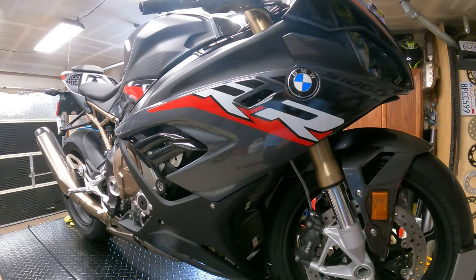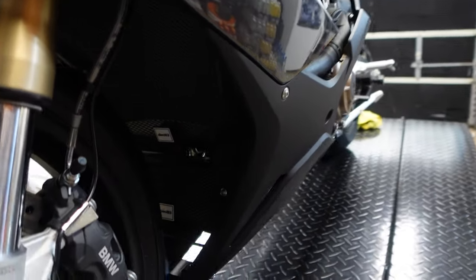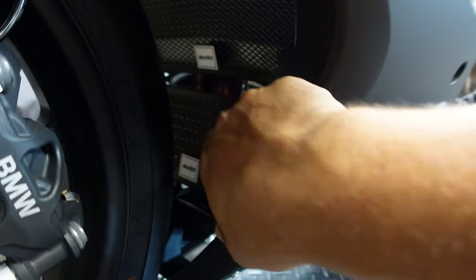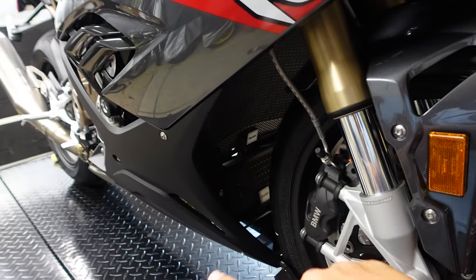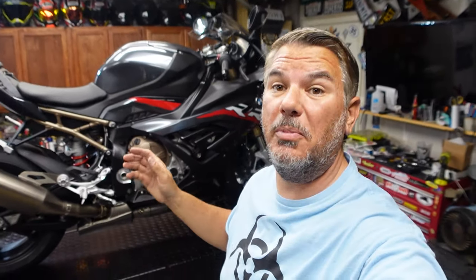Let's go ahead and get an outro and see how it looks. There we have it — the Dicey 83 radiator guards all installed, very nice. This is basically going to give you rock protection and bug protection from anything coming in. Where I put the pads in, it's quite raised off the radiator down at the bottom, but it looks really good. Make sure all your bolts are nice and secure — the eight up on top, then five on each side fairing, four under the mid section, and then the one underneath. You're looking at about an hour job, maybe 45 minutes. Very easy job, not that hard. The most time-consuming part honestly was taking the fairings off, getting them back on, and finding the thread holes. There you go — the very first modification to our 2022 BMW S1000RR.